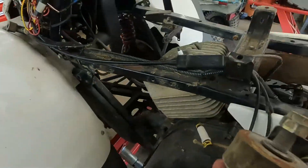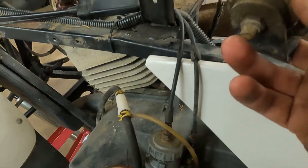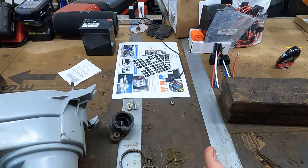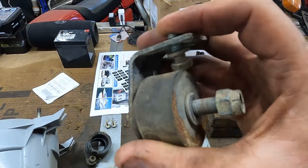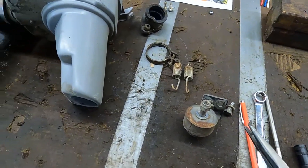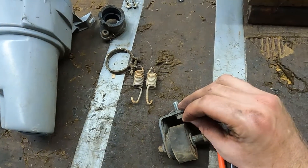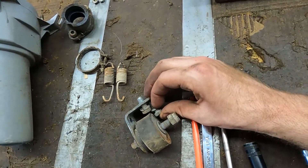I kind of fought with this motor mount. I took the nut off on the exhaust side, not the nut off towards the clutch side, and then I reached in through the top with a box end wrench first to get this top nut broken loose. But once you get it out so far it hits the motor mount, so I just used an open end wrench and kept shoving the bolt into the rubber until it wasn't threaded anymore, then reached in with needle nose pliers and wiggled it out. It might not be a terrible idea to find a shorter bolt or grind this one a little shorter when we put it back in. There was also a ground strap on this bottom bolt, so don't forget that when you go to put it back in.